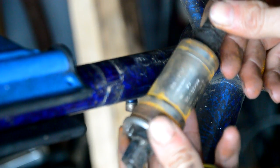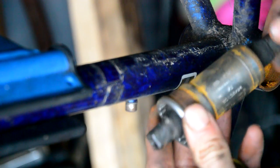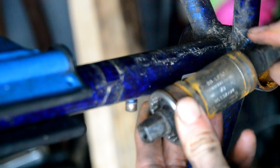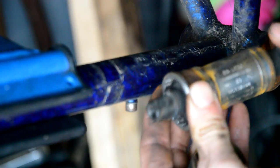It's not a cartridge, it's a BBLP30, which means it has, unfortunately, a 73mm shell. I don't know the length of this, I'll have to measure it, but it spins, though it's kind of rough. So I'm going to nip down the shops and see if anyone's got one. Also, one thing I forgot, I didn't actually check, was the top here, the head tube.